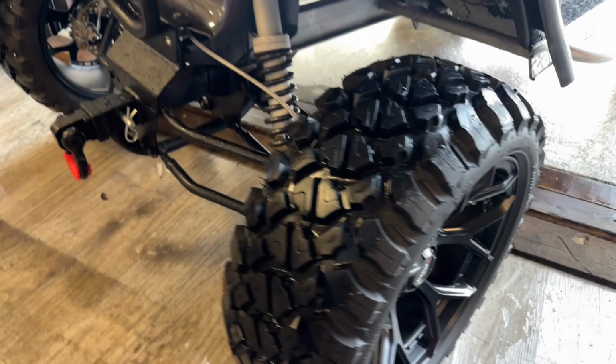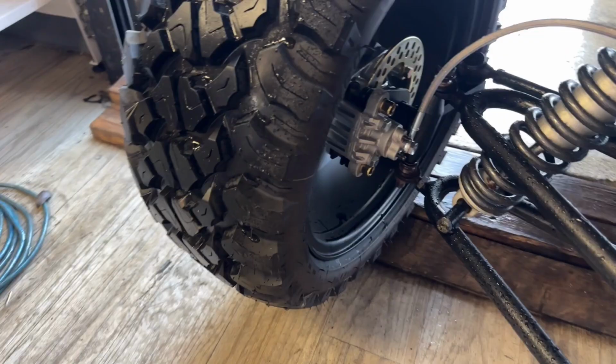All right, guys, so we finished the install on the brake kit and it was pretty uneventful aside from the hubs and trying to figure out how to get that frozen bolt out. Rob did a great job, but what are your tips for anybody wanting to install this kit? Just definitely follow the directions, read them carefully. There's a couple little pointers you do have to follow, like pinching the line, making sure you don't get air in the master cylinder, and putting it on quickly when you have the fluid, draining all the air out of the line before it goes. Just little things like that.